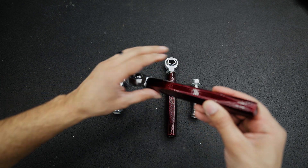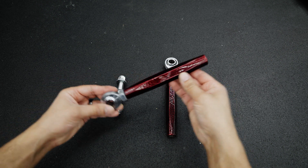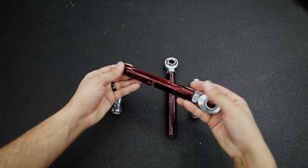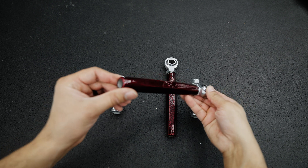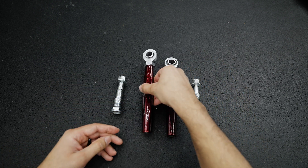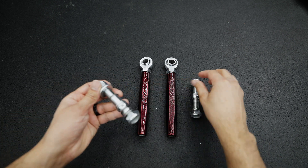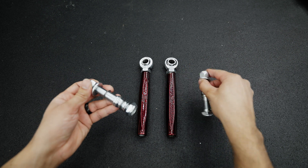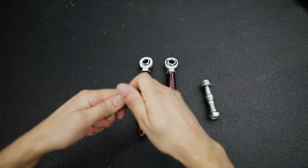Check these out — they are a full steel construction. The hex adjuster is a full steel body so it won't strip out like aluminum counterparts. They come standard zinc plated, but this customer opted for the powder coat option in a beautiful custom color. The studs are 4140 out of full billet steel and are hardened to take all your abuse.